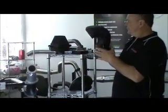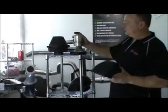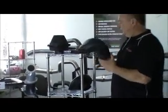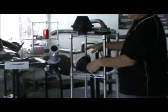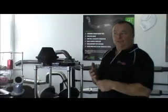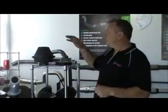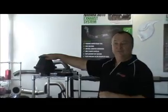We do an adapter so you can just lift the old top off, slide the adapter in its place, put the new snorkel top on, bring it down to the bottom, clamp it on, and you'll be away. Consequently, more airflow with everything we're doing will improve fuel economy and obviously help with that oil consumption problem we think is occurring because of the lack of air getting into the engine.